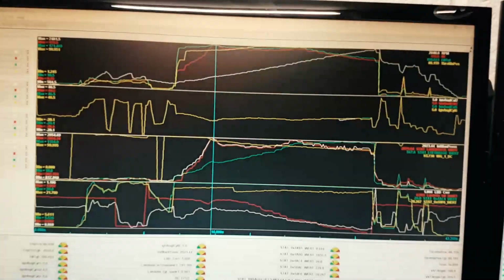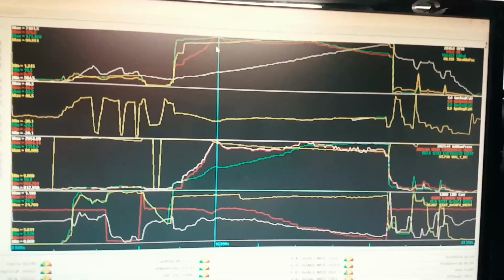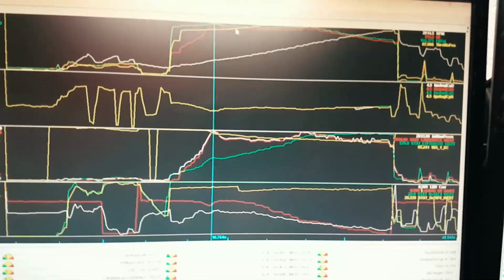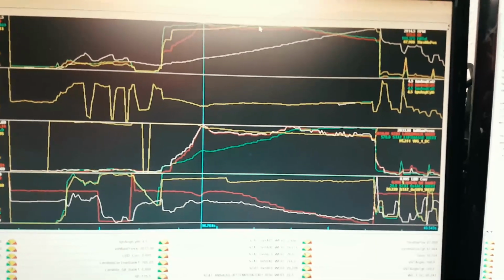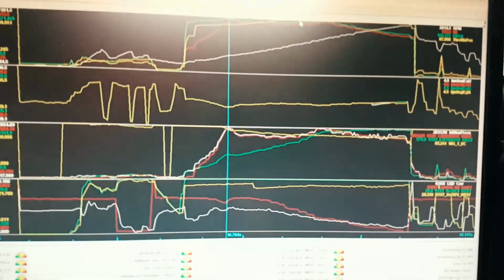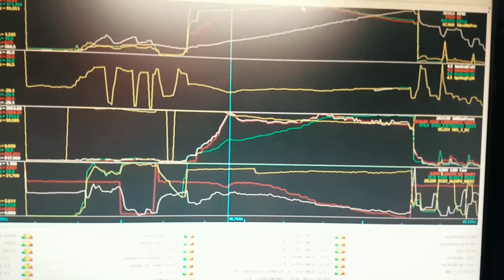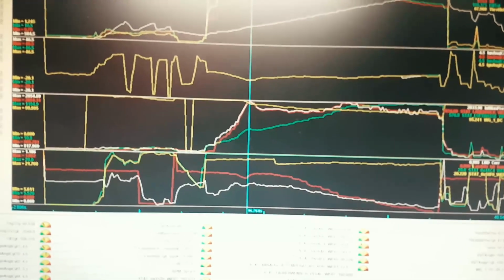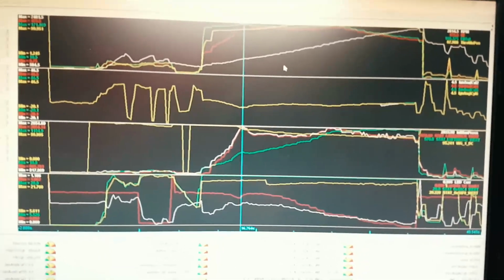So this is the actual power run that we just did on the vehicle, on the dyno. If we follow it from 2,500 RPM, you can see this yellow line at the top is your throttle pedal. So the S55 is known to not allow full throttle within the ECU until about 5,500 RPM, and that's still apparent on the competition, although it's a newer car. The car is equipped with GPF, but we're not going to talk about the GPF in comparison today. We're literally talking about the targets that make the power on the vehicle.